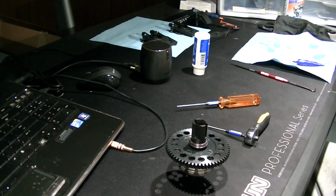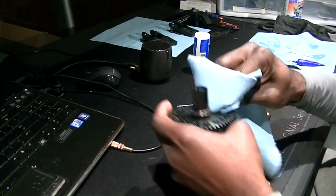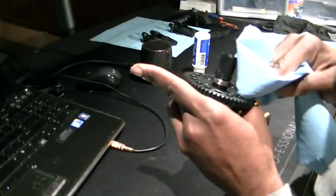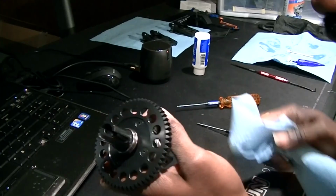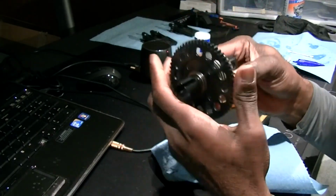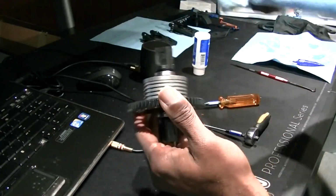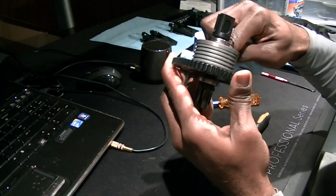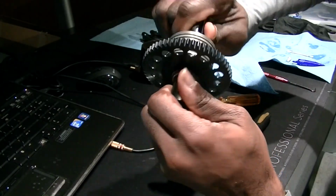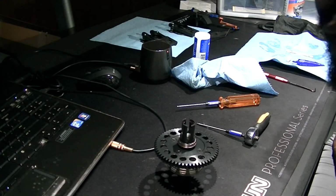And then you clean up your surface. Another shop towel, come across the top. Because of course the excess Loctite is going to be resting on top. Even though I wasn't heavy with it, it's going to be resting. And now you've got your diff. And like I said, up under it was the perfect amount of diff fluid. I'm gonna wipe around here. It's got a little bit around it, but nothing major worth talking about. Just make sure you clean up behind everything you do. And now for the test. Yeah, real tight. Yeah, perfect. And that's the install on your center diff.